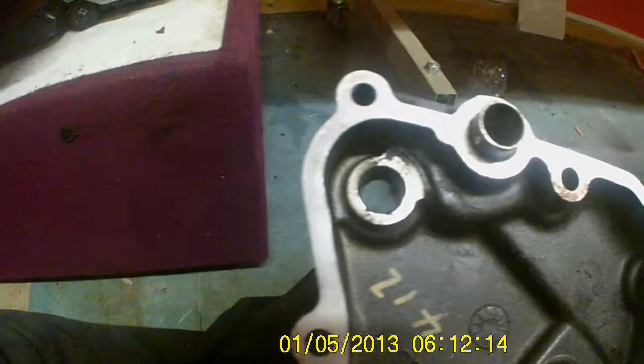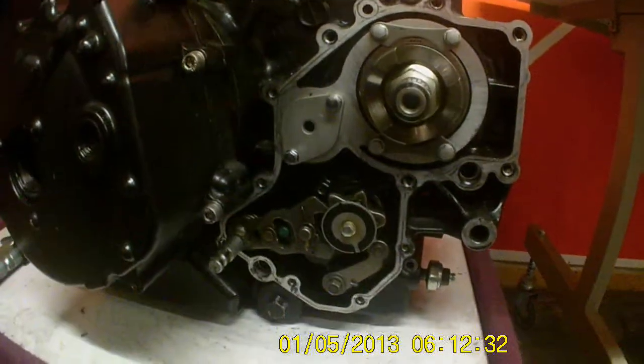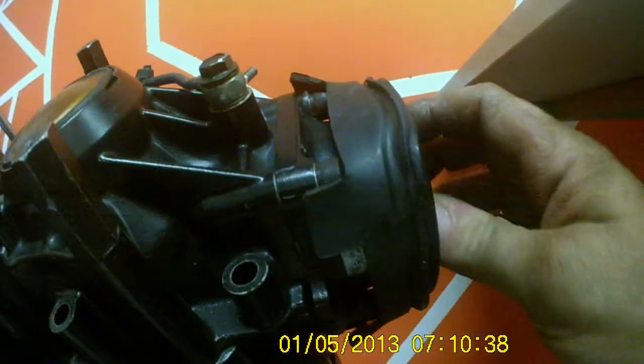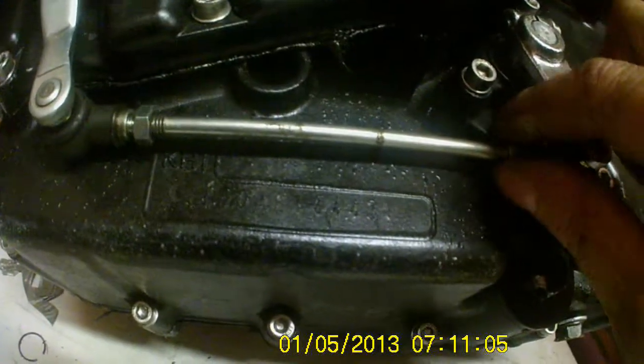This will be going on, making sure we've got neutral — the shifter is there. Get this put on and come back in a minute. Now we've got the final drive on — it's turning good. Couple of odd bolts still to put in. Basically put in, bolted down, connected up. Screwed in first with the nuts loose at either end so I can fine-tune the gearshift mechanism.